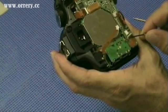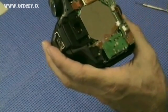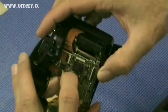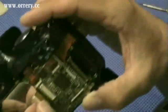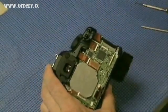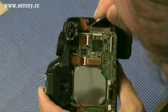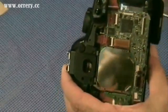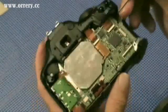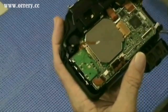The fourth, labeled D, is another hinged type connector. We pop up the black hinged part and then, with our pick, remove the ribbon cable. Ribbon cable E is just a simple pop-off connector — pop it off with your finger and it comes out of the connector on the circuit board quite easily. Ribbon cable F, in the upper right-hand corner, is a hinge type. We pop up the black part of the hinge and with the pick remove the ribbon cable. Moving on to ribbon cable G, which is next to it — also another hinged type. We pop up the black hinged part and remove the ribbon cable.